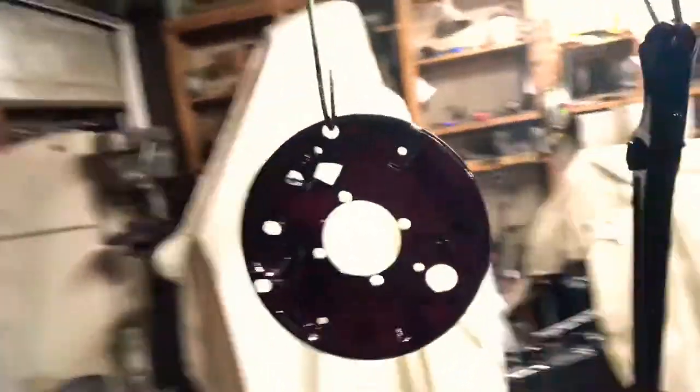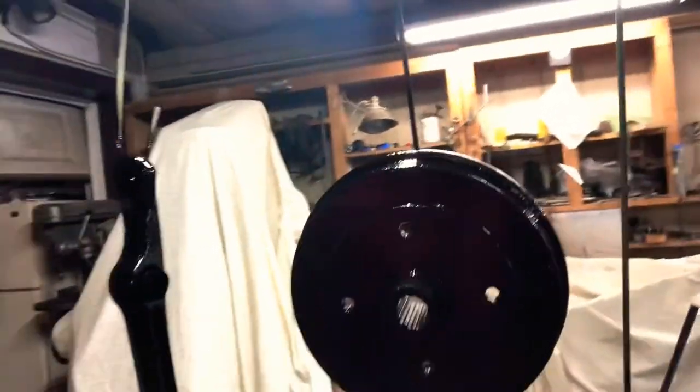The primer finished drying — it didn't take very long on these parts. A full cure is probably about 24 hours, but this seemed nice and wasn't tacky, so we went ahead and sprayed the parts with this gloss black. This is actually a chassis-specific paint made by Autobahn called Chassis Armor gloss black. It's wet right now, which is why it has that shine, but once it dries it still has the same shine — it actually looks like it's still wet.